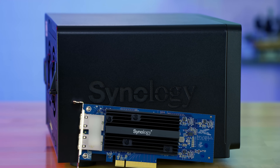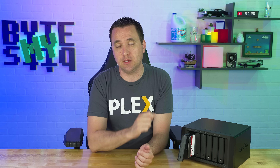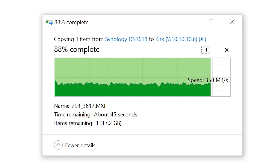That's where this thing comes into play — 200 to 550 megabytes per second backup speed, putting everything into one file and making it super easy. A common statement I hear about 10 gig networking is: can you actually achieve 10 gigabits per second? And to be completely honest, most of the time you can't, and that's okay. The point to me with 10 gig networking is not hitting 10 gigs per second — the point is I can hit four and a half gigs per second, which is literally four and a half times faster than a standard one gig connection.